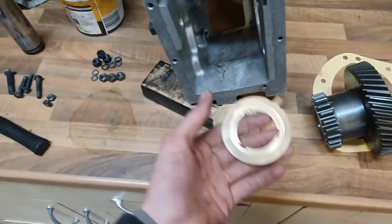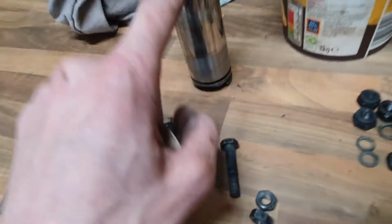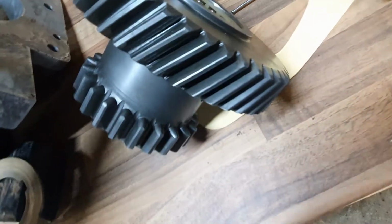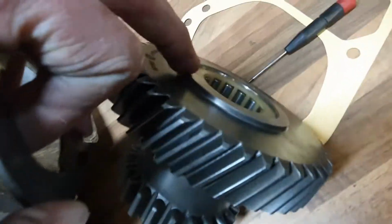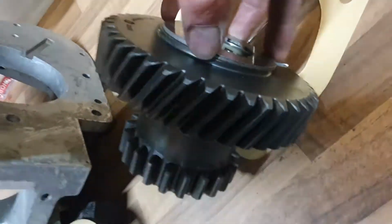So I've had a little look around, a closer look. You know, the bearings are superb, they're spot on. I've reused them, as is the shaft, absolutely lovely. So we can reuse all that. So then I had a little look, and actually the thrust force from the gear is going to clearly be going through this metal surface, nothing to do with that plastic one. Well, actually the metal surface contacts the outside of the washer, which is in very good condition.